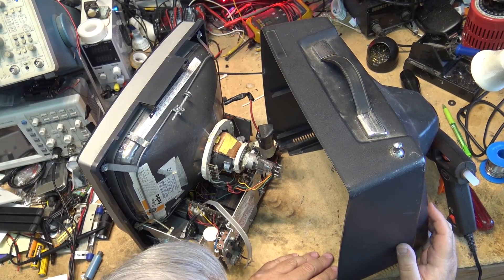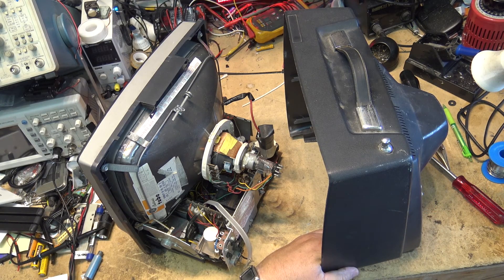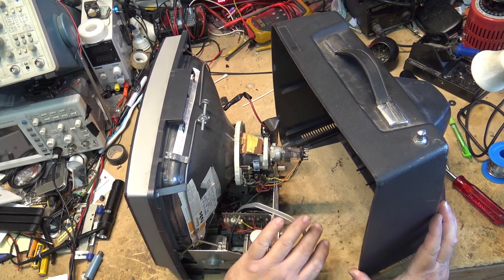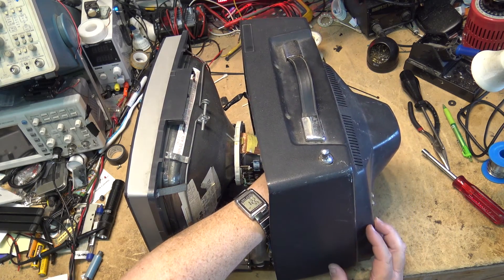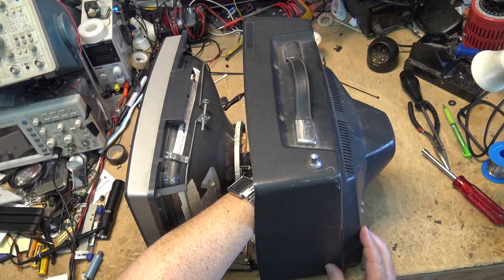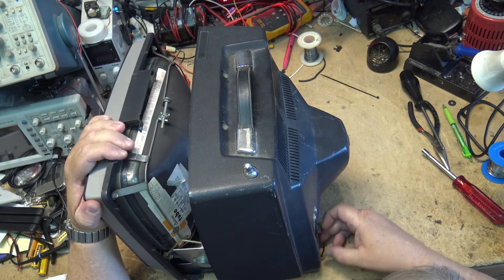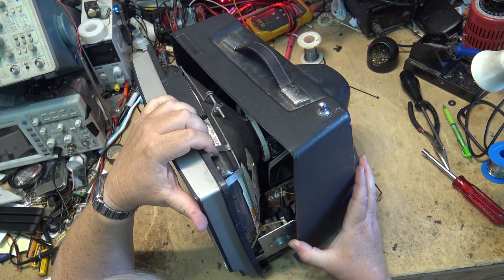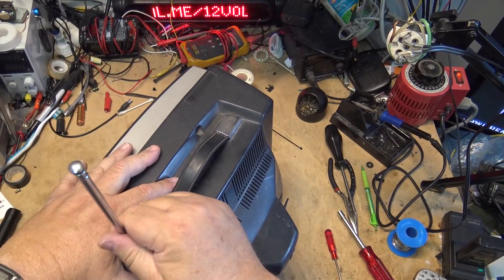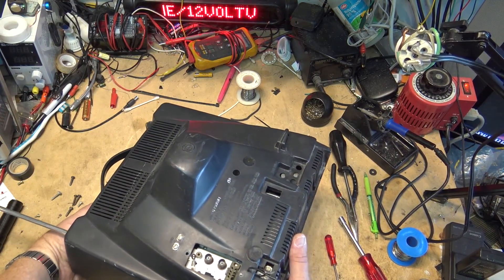The trick to putting these backs on is the circuit board has to slide into a slot on the back. It's always best to put them together sitting upright as opposed to lying on their nose, otherwise you'll never get the back on correctly. I've got to connect the UHF terminals up here, which you pretty much have to do by feel because you've got to get your hand in the back. Don't forget to pull the antenna up because it's in the way — then the back will slide on. Turn it onto its face to do the final assembly.